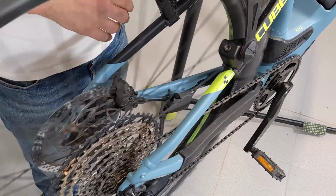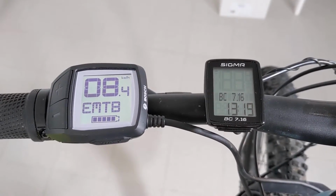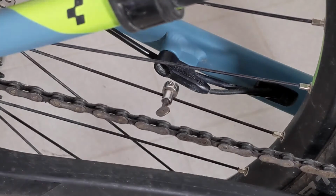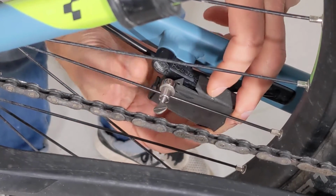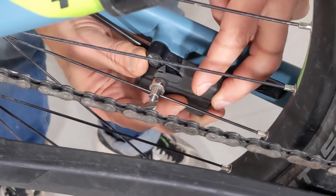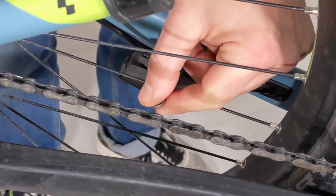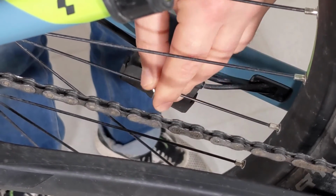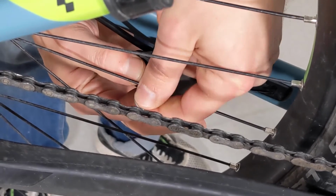Now we turn on the e-bike and turn the rear wheel by hand and see if signals arrive and are shown as speed in the display. Ideally, you should feel your way around the correct position coming from the hub until a continuous display is displayed for the first time. Always turn the rear wheel by hand and lift or hang up the bike.